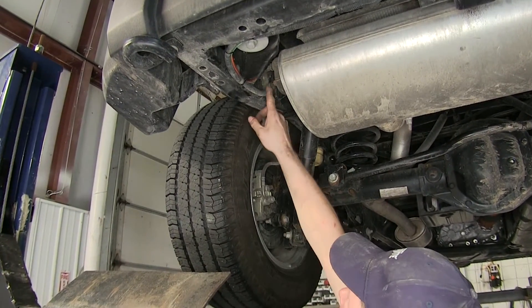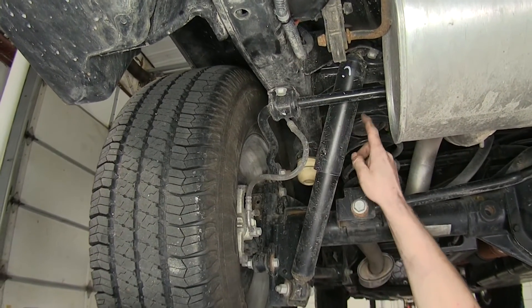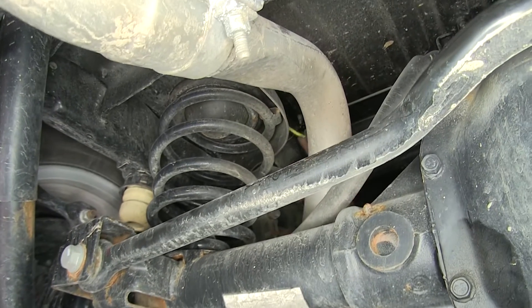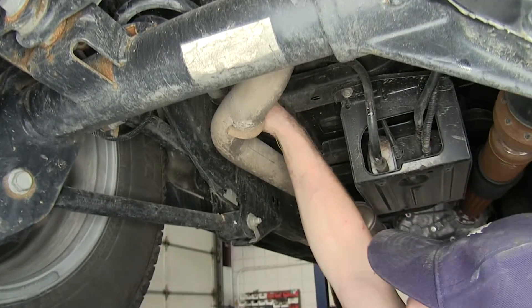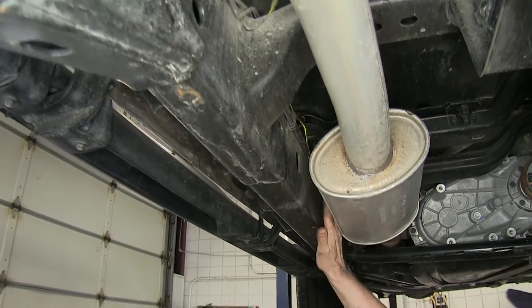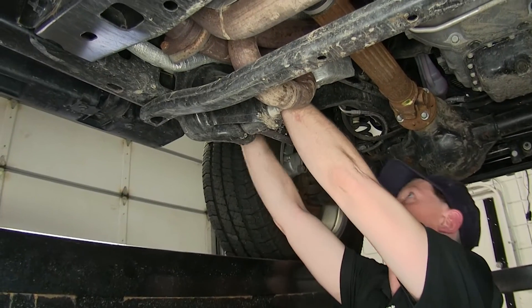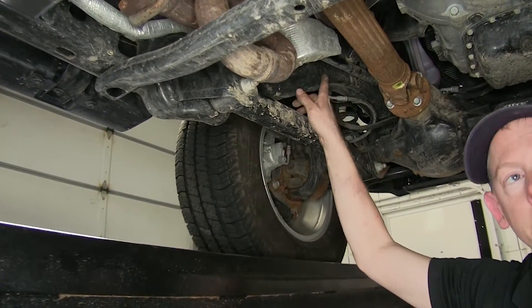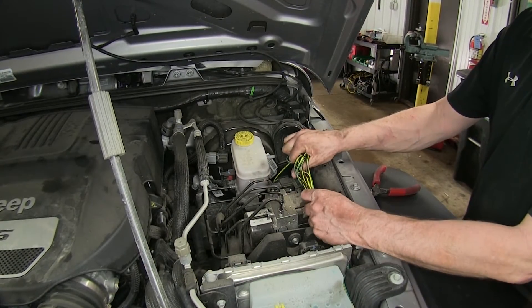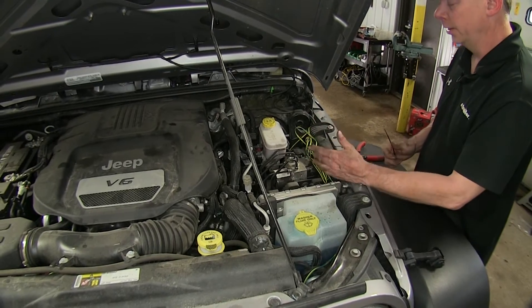I took my four-pole wire harness, started from the opening underneath the tail light, ran across the top of the frame, ran it over the cross members, ran over the top of the cross members, and stayed over all the lines and the other cross members, following the brake lines all the way up towards the front. From there, I went over the frame and stayed on the outside of the frame until I went up to the fender well and ran straight up. Once I got to the top, I ran it down towards the front and took my excess wire and bundled it up. Sometimes your supplemental braking system needs access to these wires, so it's always a good idea to keep them handy.